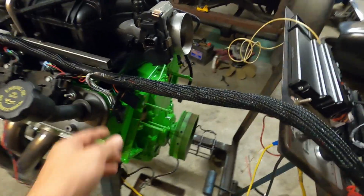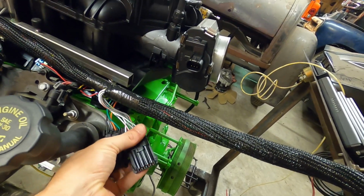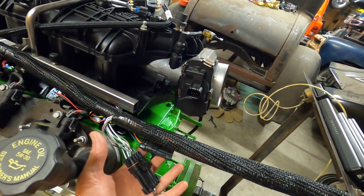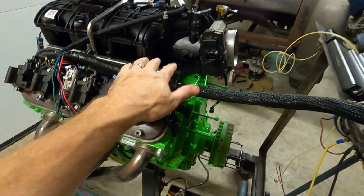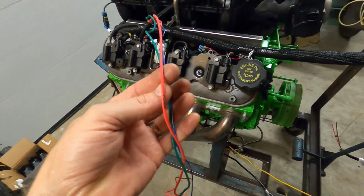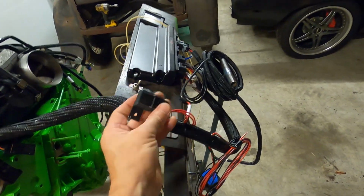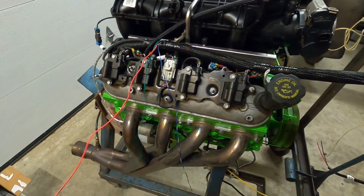And while we're right here on the battery side, there is two plugs here with caps on them. You're not going to use these. We're just going to call these accessories. So this is the input output, and we're not going to use these, especially with this setup on the run stand. No need to mess with them. Here's the wires we have uncoiled. So this red wire says fuse on it, and this goes right to your battery. That's what actually powers this fuse we were talking about earlier up here. So that's a fusible link that goes right to your battery.